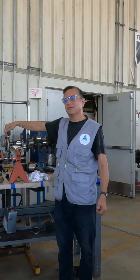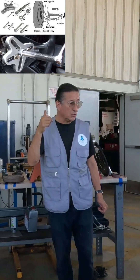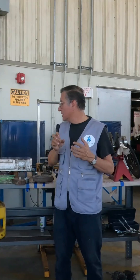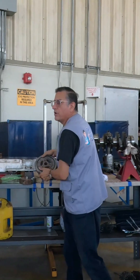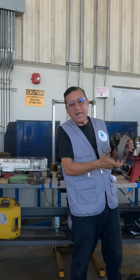How can you damage the harmonic balancer? When we remove the harmonic balancer, we use a special tool — this is the unique tool designed for that. Some people say no, they want to remove the harmonic balancer with a regular puller with three legs, which is how damage occurs.